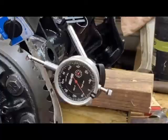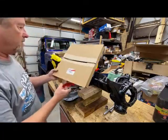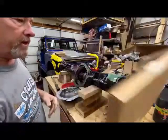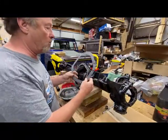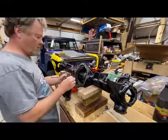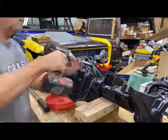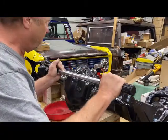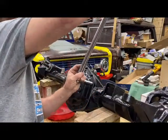I'm ready to put the cover back on the differential. I'm going to use a Spicer performance differential gasket — supposedly you don't need RTV with this. It's a metal reinforced gasket with Teflon on one side and adhesive on the other. I'm going to tighten all the housing cover bolts to between 30 to 40 foot-pounds; I've got it set for 35.